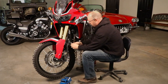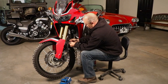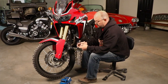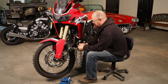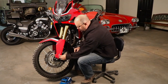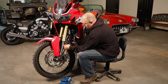Next, take the 10 millimeter wrench and take off the retainer. Open that up, pull out the brake line, snap it out, and set it aside. We're not going to use that retainer, but we will reuse the bolt with a different mounting technique. Now the back of the fender is free. Go back and take off the rest of the bolts.